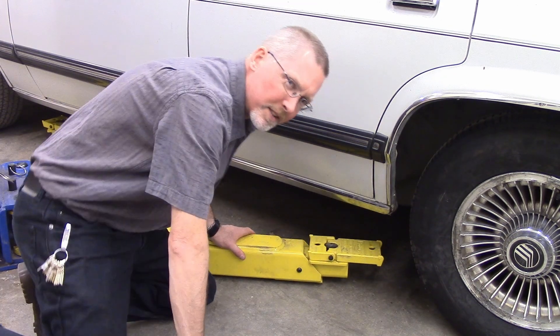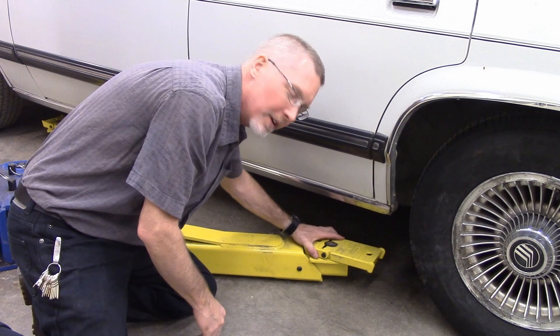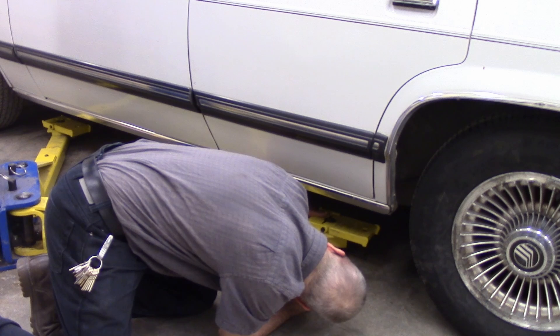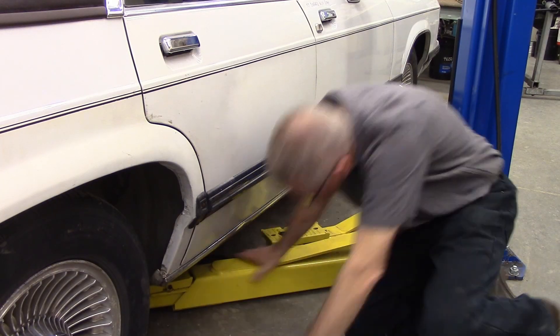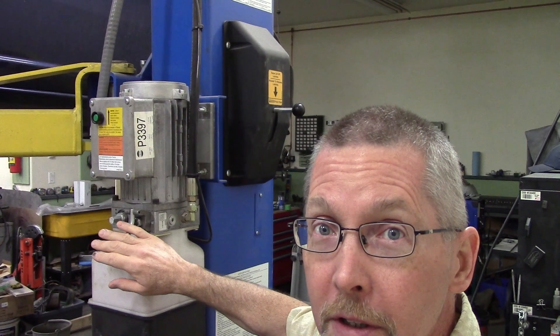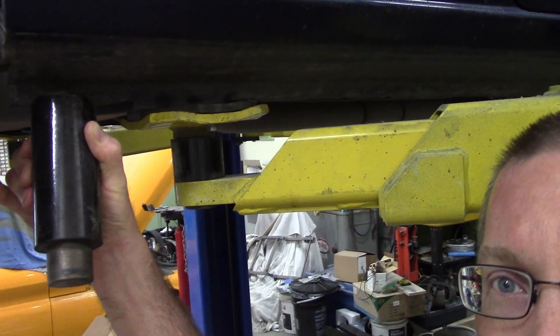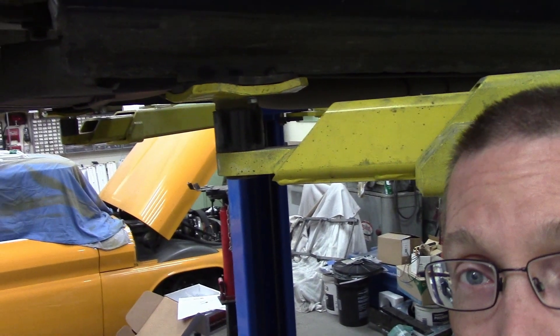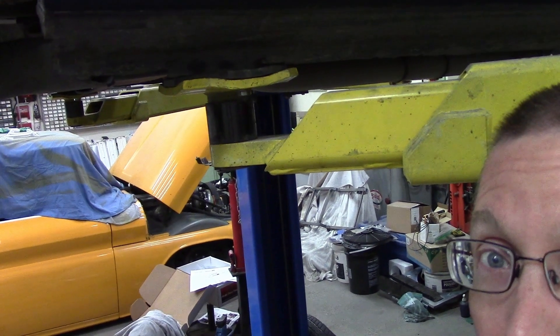Different vehicles might have different positions where you want to lift from. We do have a book that shows you where to go, and you're going to get me to check it before you lift — I don't want you to lift your engine out of the car. This is my two-post hoist at home, same brand, just a slightly lower level of perfection. Controls are pretty much the same: power button to go up, lever to go down, release the locks and hold it down just like the other one. This one's a little different — it's got saddles and pins, and different pins to change how high the saddles sit to hold the vehicle up.